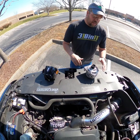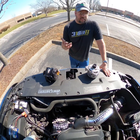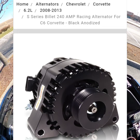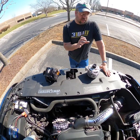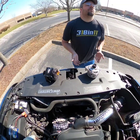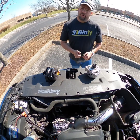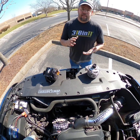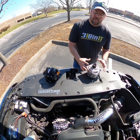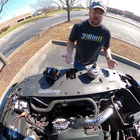Whereas the small case may not charge at all in that situation. On the website we note this for some small case units — the C6/C7 Corvette comes to mind. We sell a 170 amp that bolts right in and does everything it's supposed to, but we also make a 240 and we note on those 240s that it will not charge better than factory at idle unless you can pull that idle up to 850–900 RPM, which you can do with a tuner or a cam by bumping idle speed up.